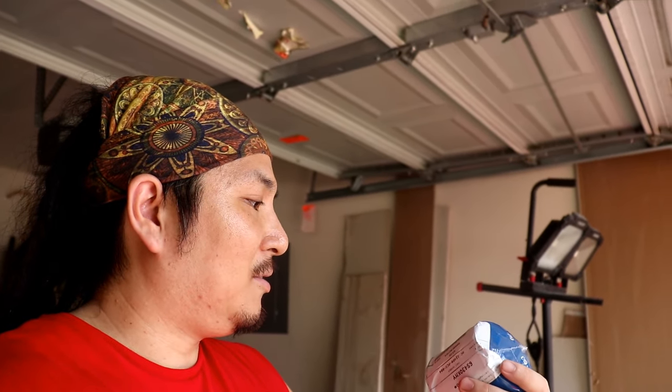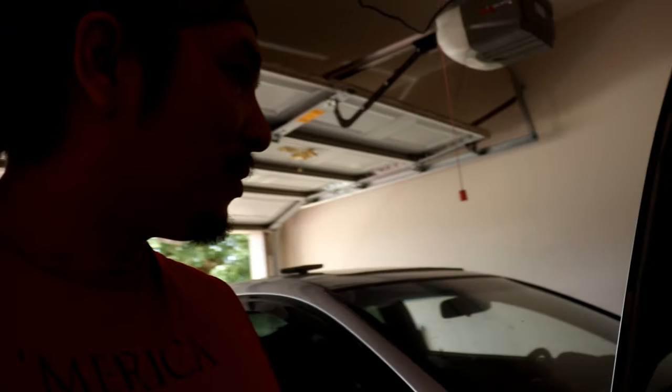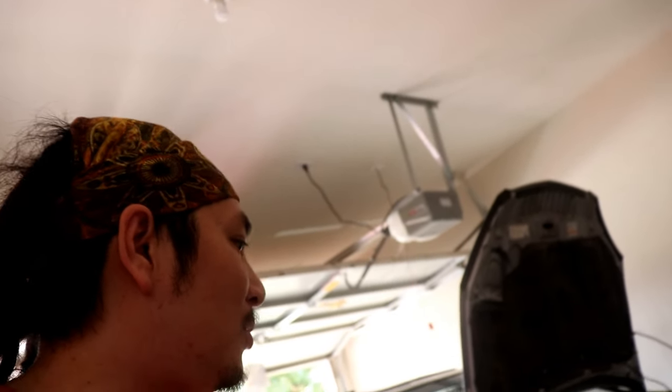All right, all y'all RSX guys, we're gonna be doing the oil. Well, I'm gonna be using an S2000 oil filter. Supposedly it's a lot better, with better oil pressure, and surprisingly it fits. So hopefully we'll get a decent amount of pros over cons when using this filter. I didn't even know we could do that until Steve looked it up, that apparently some people run these filters on their K20s. So they're supposedly better than the normal Honda ones.